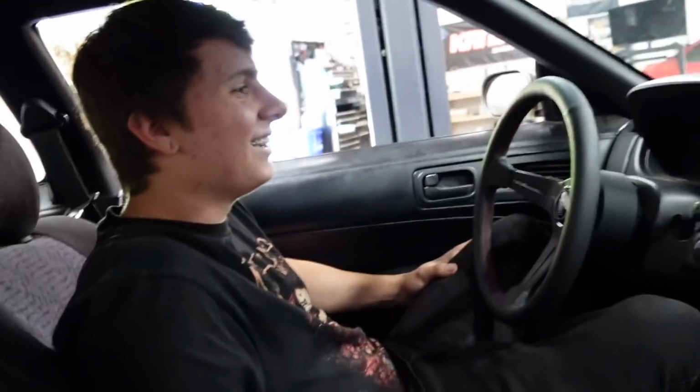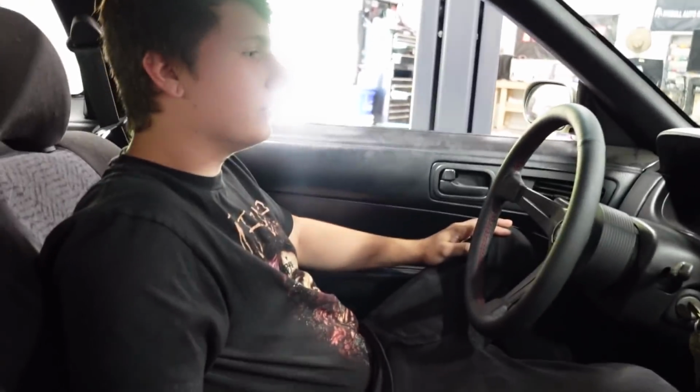You know how healthy that engine sounded? That thing sounded like a 30,000 mile engine. Dude, I love that. It started right up. It wouldn't stay idling though. I'm not surprised, there's no IAC. We haven't set that. I haven't turned any of the advanced idle control on at all.